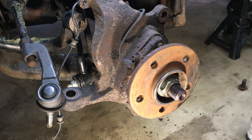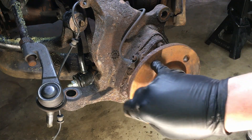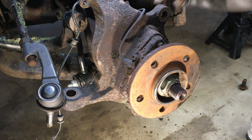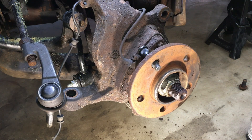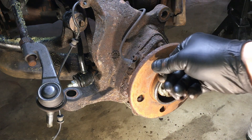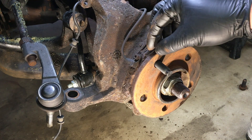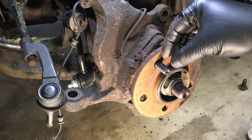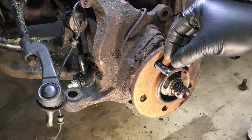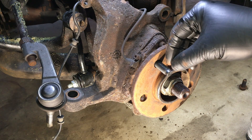Now going back in — make sure the hole you're pressing into is not damaged in any way, not walled out. Guide the stud back on through. With the rust we're going to have to fight a little bit, just give it a little love tap like so. Center it in there as best you can — it'll be loose because it is a press fit. At this point you can get a couple thick washers, slide them over it, and use a lug nut you don't need anymore that's the right thread — but be careful because you'll damage it with repeated tightening.